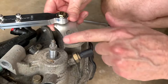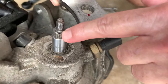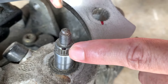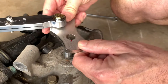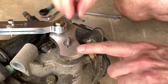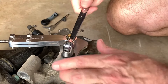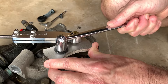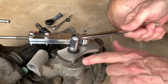To get a good adjustment, it needs to go on smoothly and be able to move back and forth. Next, there's a keyway marked with a red marker, and there are two joined keys on the spline shaft that I've marked with a black marker — just two of them right together. We're going to line those up, and once they line up, it just goes right on. Then put the new black nut we supply and, with a 13 millimeter socket or wrench, rotate it on and tighten it down. It needs to be good and snug, but don't go totally nuts with it because you can break the stud off.